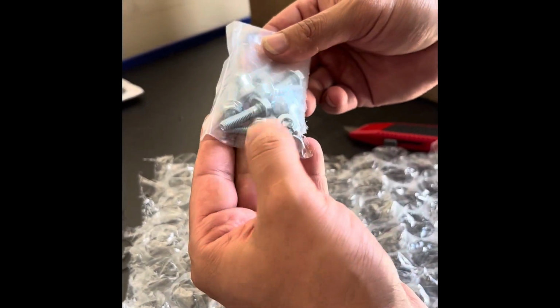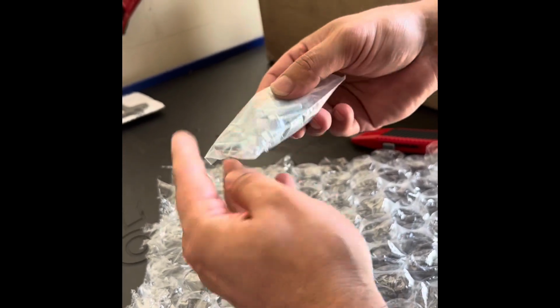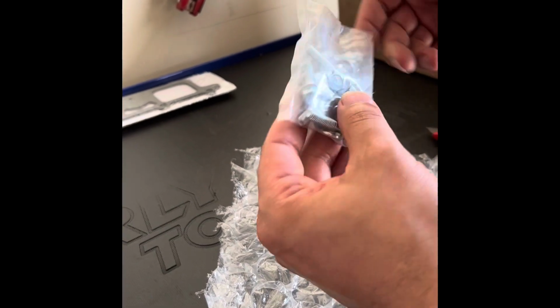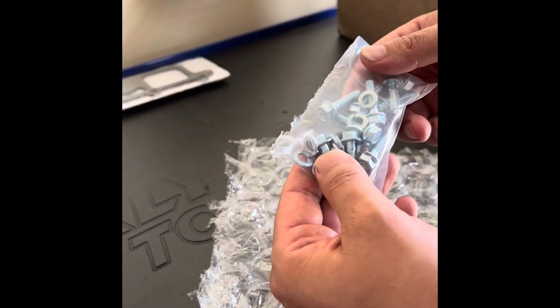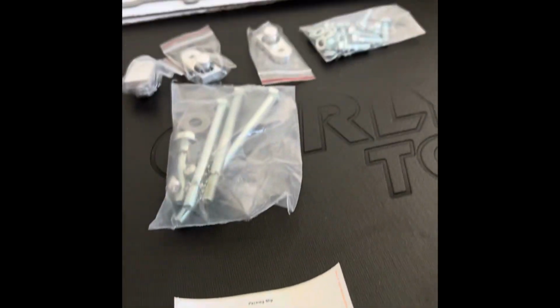Your bolts. So these are the bolts that you're going to mount your brackets to. They go into your heads. Now remember, these don't take a lot of inch pounds. So that's something I'll look into too and find out what they recommend. I think I was using like 15 to 20 inch pounds, or maybe about 10 foot-pounds. Oop, well, that fell out.